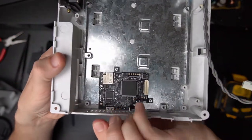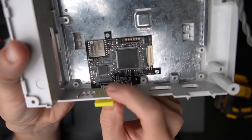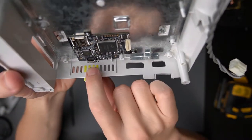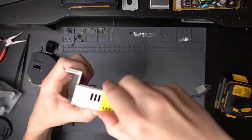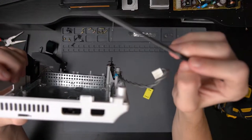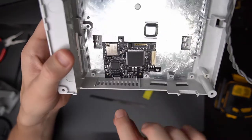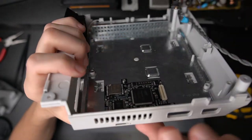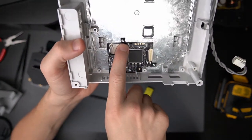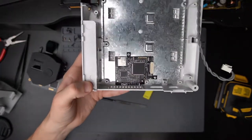The other thing you should do is just look at where the holes are in this HDMI port — the drill block should kind of go right over where that HDMI port is, that way you're not going to mess it up. After you've got those five holes with the drill, I just took this file here and filed out a thin hole for the HDMI port on this mod to go into. It's got a nice snug fit and it sticks out the hole on the side — that's where you're going to plug your mini HDMI cable in. And the last thing I did was drill two screw holes, one here and one here; now I've got two screws going through the case to secure the mod to the Dreamcast.